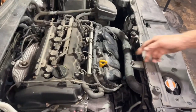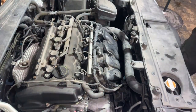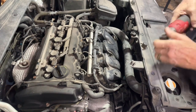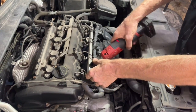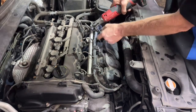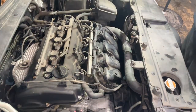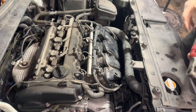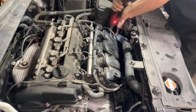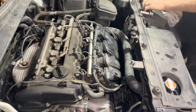Let's go ahead and pull the oil dipstick tube, our oil dipstick out. Place it up there. And get that wiring harness that's on top out of there first, and probably maybe the injectors. Let's see how it goes. Put the pins on top there. Whoop! I knew I got my light. A tin here on the side. I am going to drop that upper coolant hose. I'm just setting all my nuts and my bolts up top.